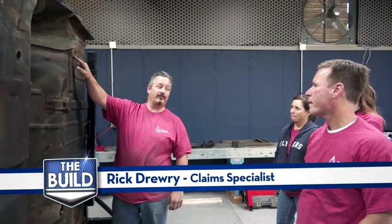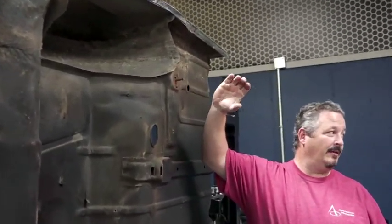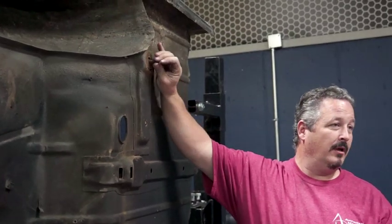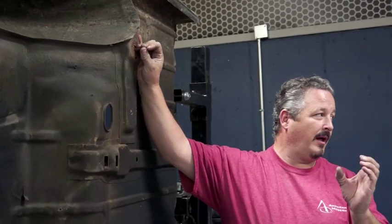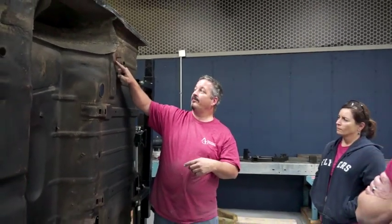What we've got to deal with — you can see a little bit of rust right here. This is a body mount. This is what goes through the frame, down through a hole, and then you run into this bolt. That's what clamps the body to the frame, the frame that we've been grinding on. The problem is, with this being rusty, this will give away and break, and then all of a sudden the body will start bouncing on the frame. It can't happen.